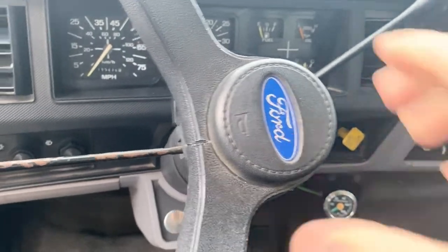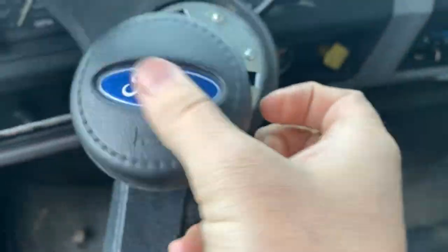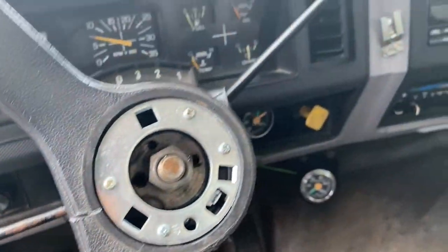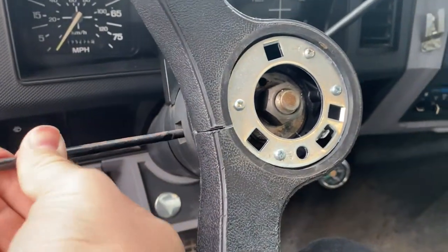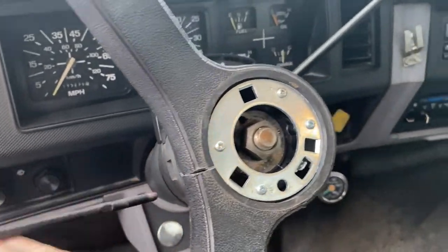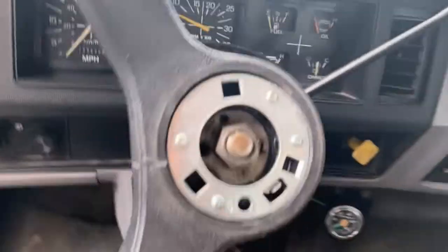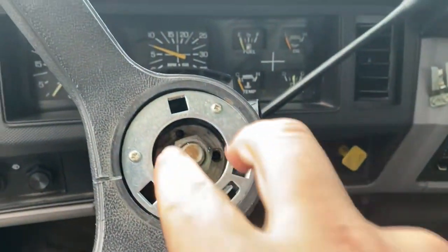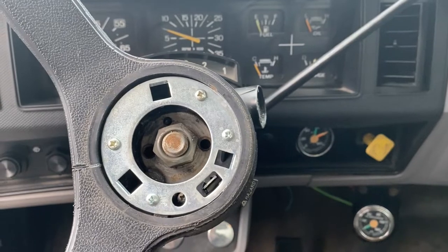In theory this should be fairly simple, but I know that probably won't be the case. We're going to first take off the horn — it just unplugs here — and we also need to remove the blinker switch and unscrew that. As you can see, the tumbler has a port where you can push in and it releases, but because of the broken key in there we're going to have to take that bolt out. Then one of the puller sets will thread into those two holes, we'll tighten the bar, and it should pop the wheel right off.